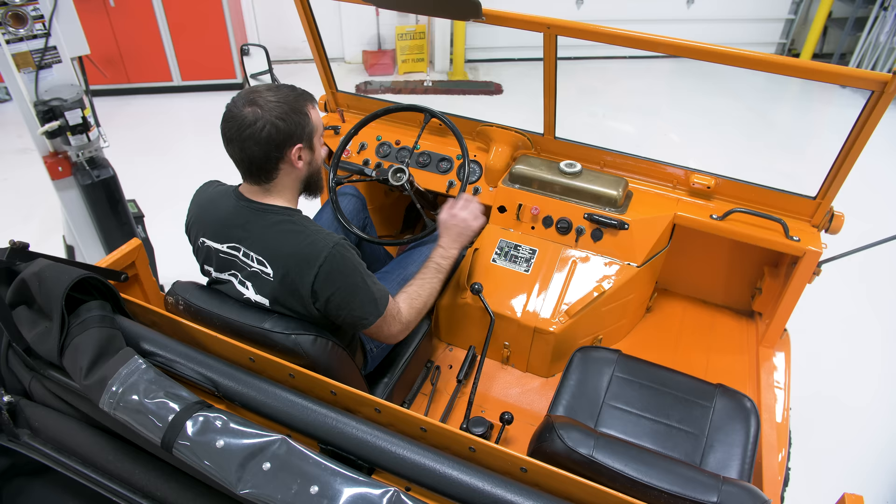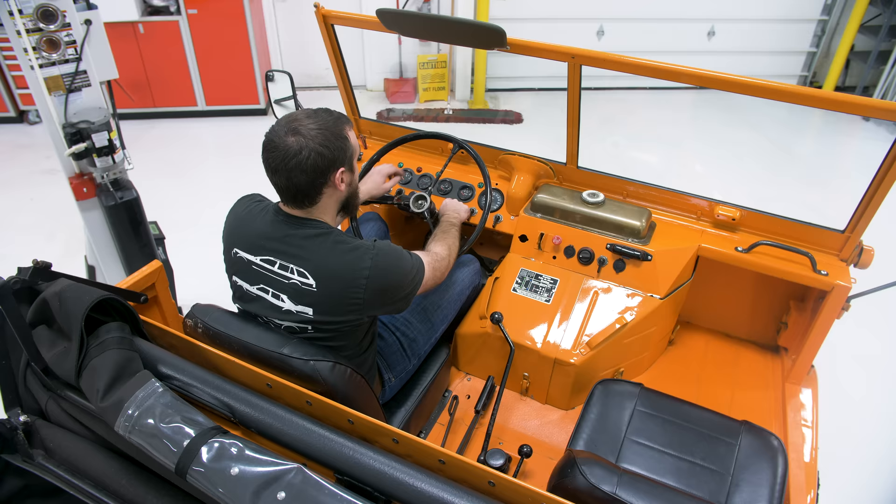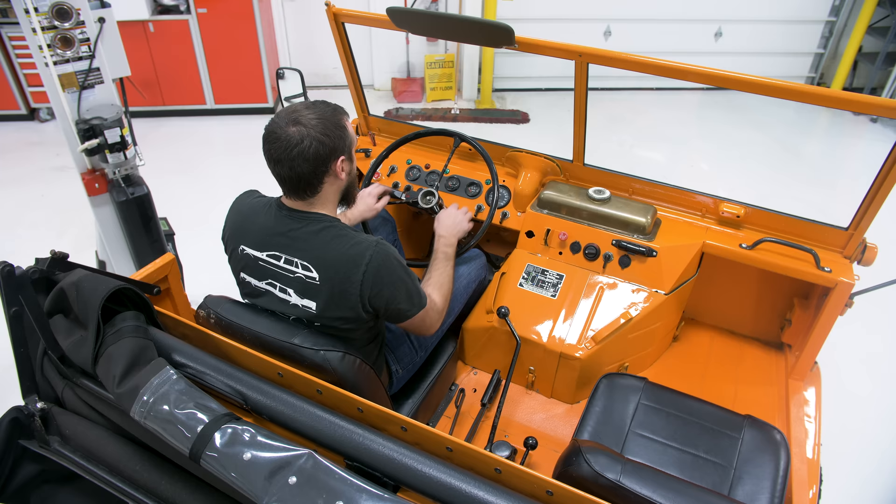It's pretty simple in here, but it took a lot to get here. These were all 24-volt originally — I converted everything to 12-volt, and there are different gauges now because back in the day they used a very oddball size. These are the normal two-and-a-sixteenth inch gauges, but the hole was actually bigger in the Unimog dash originally. So I made this adapting bezel piece, had it plasma cut, found a speedometer that fit, and then put in a couple more indicators.